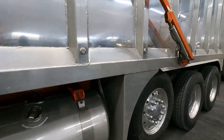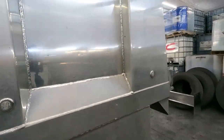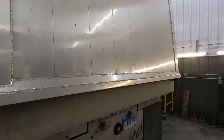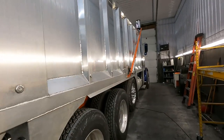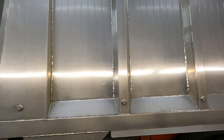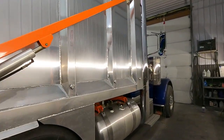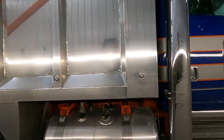We're gonna go through, give it a good wash. We're gonna sand it all down. Polish it up nice. I mean, it's in pretty good shape, but you can tell it's got some pits in it. And that lighting, it's definitely got a lot of surface scratching. And it's really dirty. So we're gonna go through, probably do rotary sand on this, some 600 and 800. And then we're gonna go through our polishing process, get it real shined up.